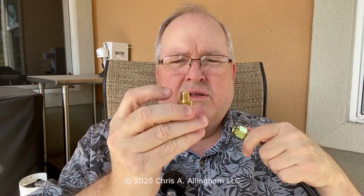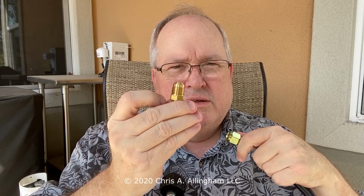The trick though, and be very clear about this, is that on the 1/8 inch NPT end, you do need to put pipe dope on this end and screw that into the manifold. But no pipe dope on this end. On this end where you see this wide flat area right here, that is a metal on metal connection. That flat surface mates against the flat surface inside this connector, and you screw it together by hand, if I can get it going. And then you have to use two opposing wrenches and make this mechanically tight in order to seal these two together.